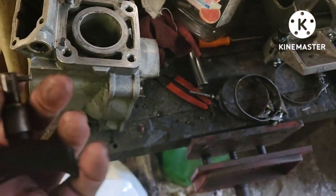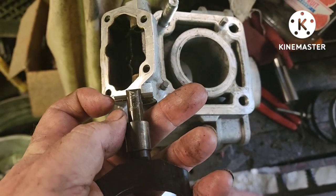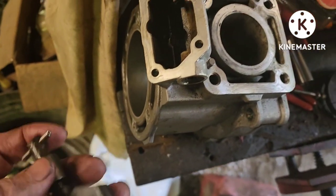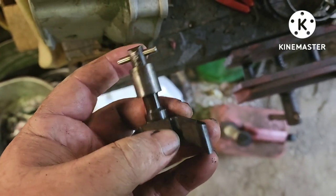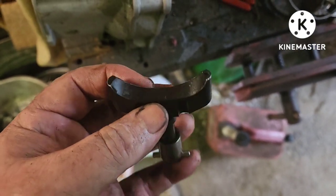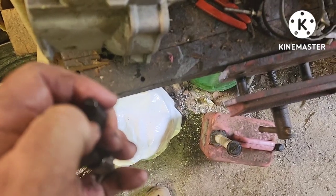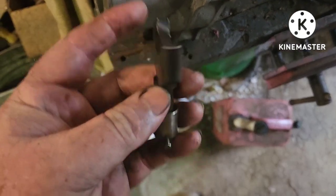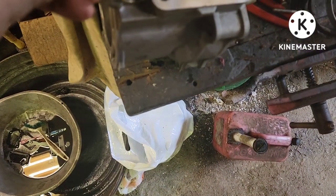Don't damage these. The problem that older versions were having is this pin would come out when the engine heated up, things dropped down — I mentioned that — and it would tear your piston to pieces. Supposedly they fixed that problem. This 1300 is the first I've ever worked on. Lots of carbon build-up on these that you've got to sand or grind off with a wire wheel brush. Let them soak — it'll make it a little softer and easier to get off. Once again, that scalloped edge goes down when you're reinstalling.